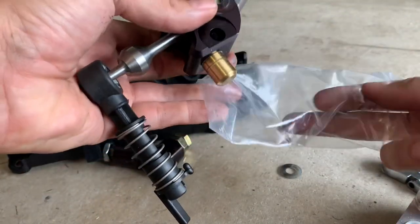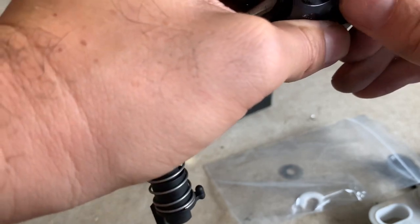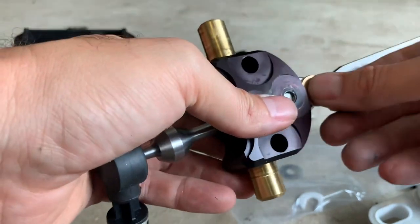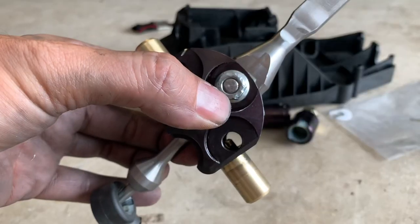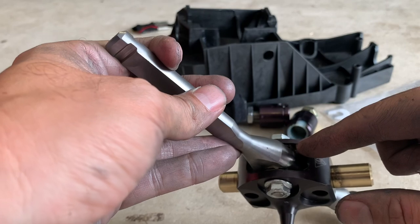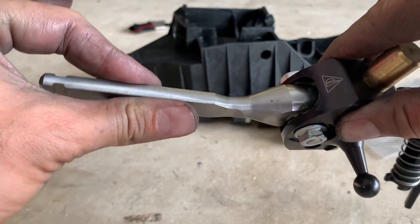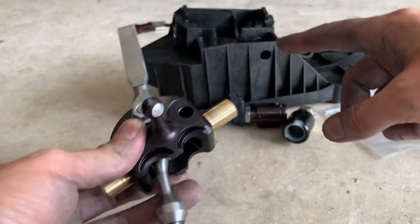It comes with a washer - I could reuse the other washers but this one is a little bit thicker. I've got to jam it in there though. This kit is for a B&M branded shifter and this is clearly not, so it may not fit, but it's supposed to. B&M shifters should have more room - we might have to reuse our copper washers. Because it's not a B&M shifter it took a bit of trial and error, but we got the roller bearing in and used one of our thin brass washers since the supplied one was a bit thicker. There is now zero side-to-side play - absolutely none, not even the slightest. It's all greased up and smooth.